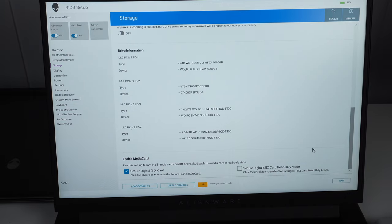I tested all drives with CrystalDiskMark to make sure everything's running as it should. The speeds on the SN850X are absolutely phenomenal — really pleased with the performance in this machine. The P3 Plus is also performing better than I expected and will be a great games drive, giving me eight terabytes on those two main drives. The SN740 1 terabyte drives also perform really well, which was surprising. However, they do run quite hot. Since Dell doesn't provide heatsinks for those 30mm drives, you'll probably need to source some yourself — I'm currently trying to find some and will link them in the description when I do.